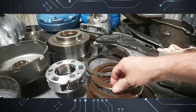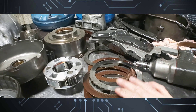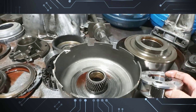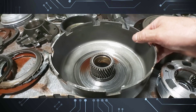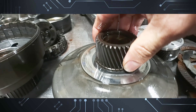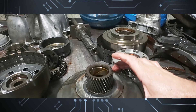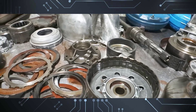The direct frictions look decent — a little crystallized but you can run a buffer and get rid of that, no big deal. The real problem is the broken pump washer: the gear train was slapping back and forth, which caused the sun shell to fail. The sun shell is worn — you can see it go up and down. You can actually upgrade this sun shell with the front planet from an E4OD to get a deeper first gear, but that's for another video.